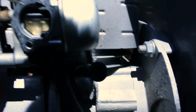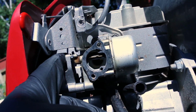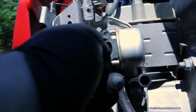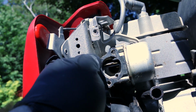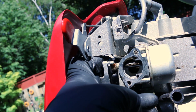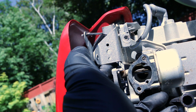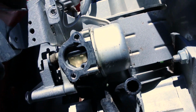Alrighty, so what it's got, it's quite interesting. It actually runs the throttle plate on the outside closest to the air cleaner, and it's hooked to our governor by the looks of it. Now, I'm no expert on this carburetor, but in behind it, hooked to a linkage, is another plate down in there at the back side, and that appears to be our power enrichment. Now it doesn't slam on with any authority when I roll this up to choke. In fact, it holds it off, but the linkages look like they're assembled correctly.